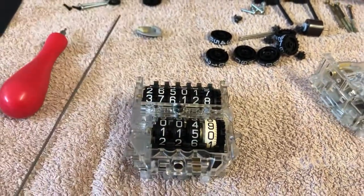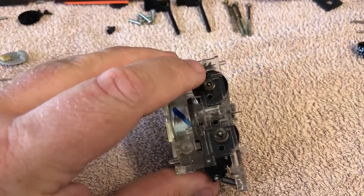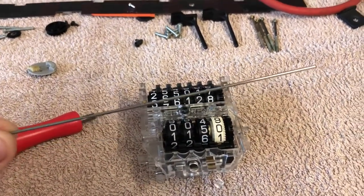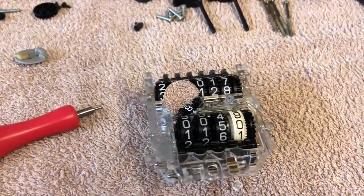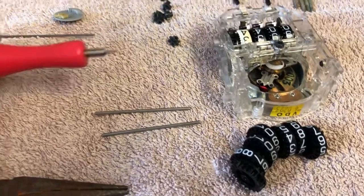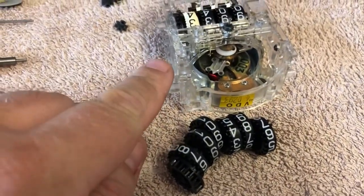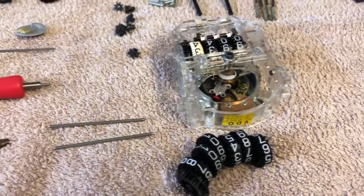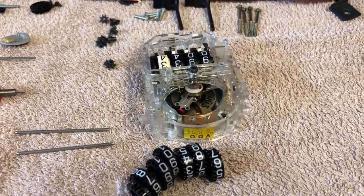I'm going to put the tool in there and push that pin out to get everything out of the way so I can remove that little gear. I've just used the tool to go in on the side and punch that pin out a little bit, then use the rod to push through and remove the pin completely. When removing these pins, they can be very firm when you first punch to unlock. Once you expose a few millimetres on one side, use pointy nose pliers to gently pull it out. These plastics are old and brittle, so take your time and be careful.